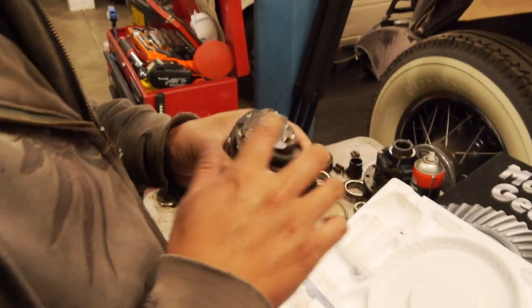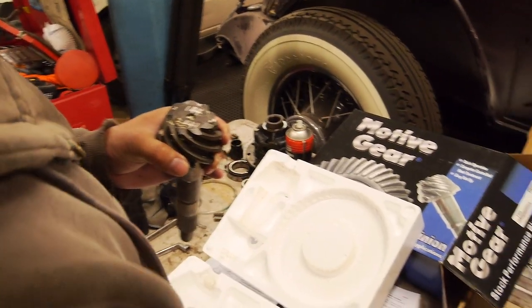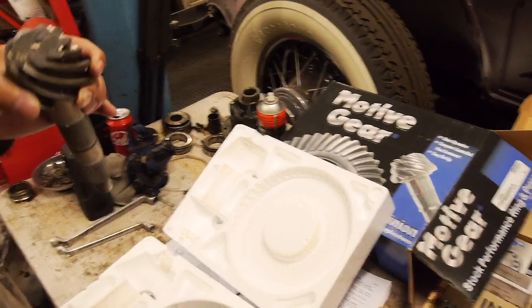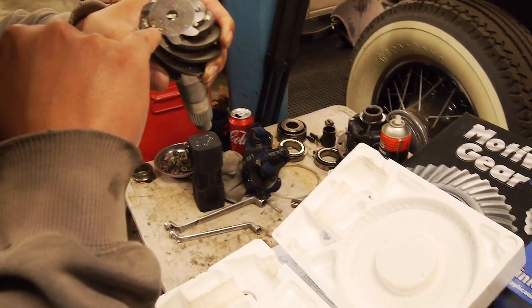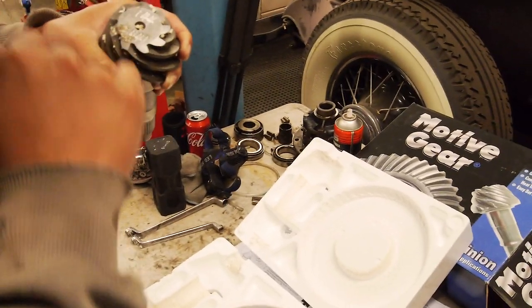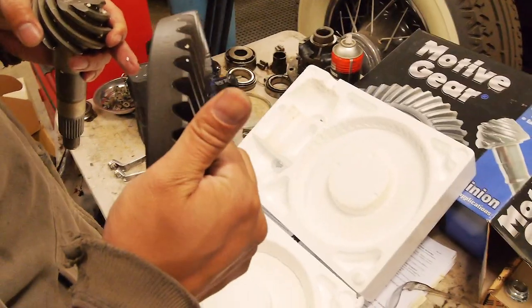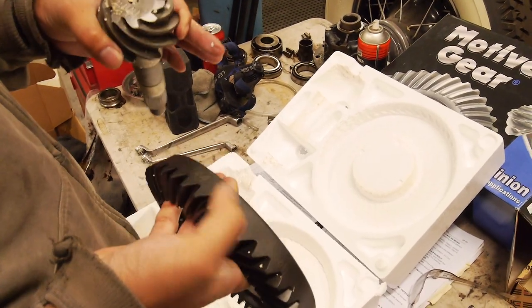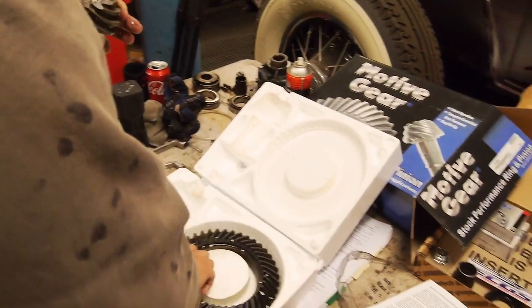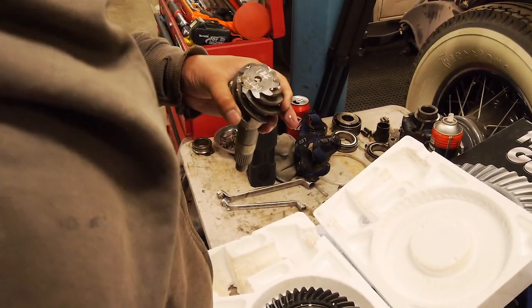So that looks like the serial number, I think, 144. It's either that or it's the offset distance. It's usually offset, isn't it? I think that might be the one there. 2441. 2.441, 2 inches. Yeah. Let's see what this says. 144. So this is gear set 144, and the set distance is 2 inches 441.